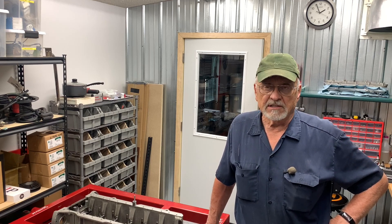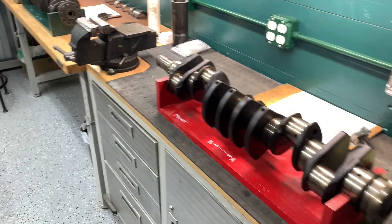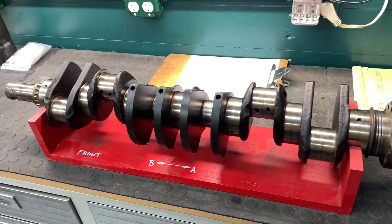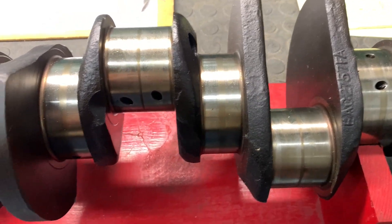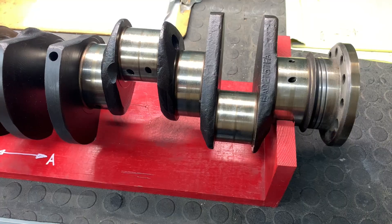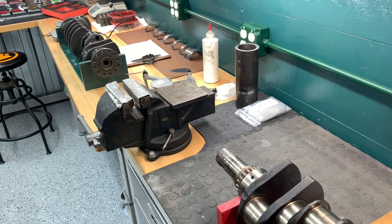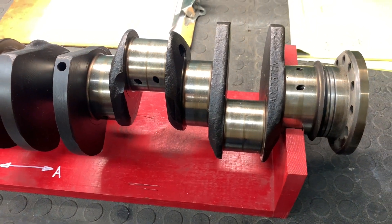Let's see what the differences are specifically between a standard 5.3 crankshaft and the 6.1 TWR unit. What we have here is two crankshafts that look very similar. This is similar to the one that's in the E-type engine right now — I just pulled this one out of crankshaft corner as a comparison. It's pretty dirty, that's why it's in crankshaft corner. Now, the thing about Jaguar V12 crankshafts in the 5.3 liter range — to my knowledge all of these crankshafts are forged and all of them have been hardened by the nitriding process. If you're going to have these crankshafts ground undersized, they need to be re-hardened. A very important thing.